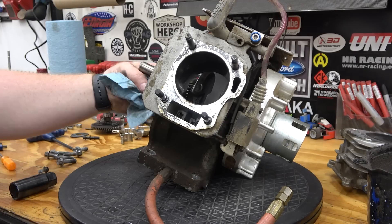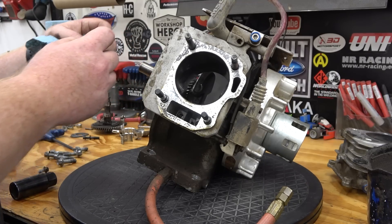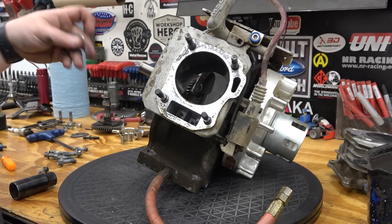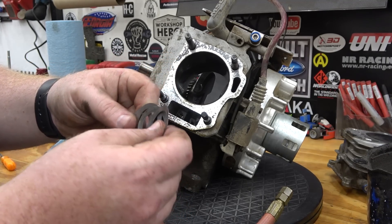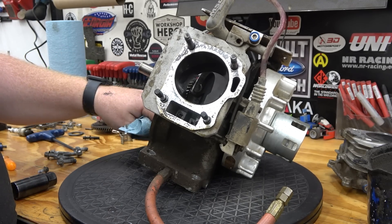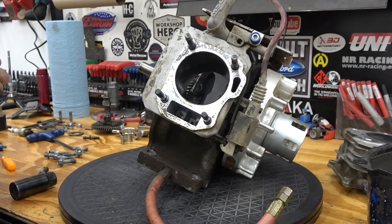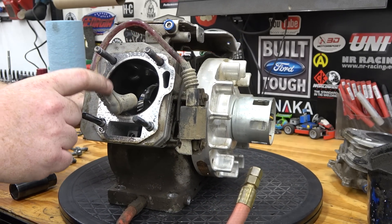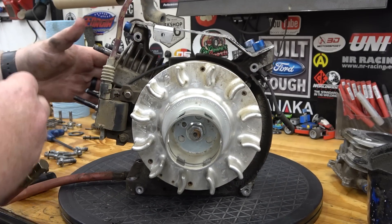We actually had to run five shims — three thick and two thin. That was a lot of end play. Way too much end play. To know what we know now back then — but this engine was a trooper. There's the bottom of the block. I'll drain the rest of this oil and we'll get a good look at it. I just noticed the chunks of that bearing are actually laying on the crank so we'll be able to retrieve those. It's actually kind of exciting.